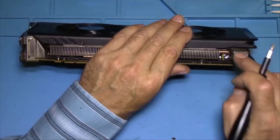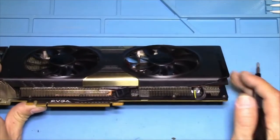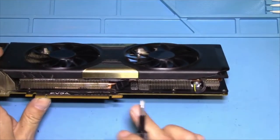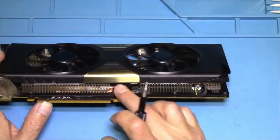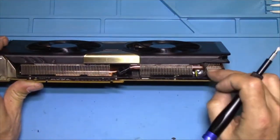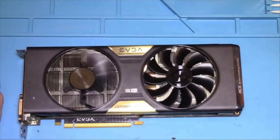When we do learn something, it is nice to be able to share that knowledge with others. Even though it's a little bit of finagling, I finally got it started. I'll just use the screwdriver to seat it down. On this particular fan, just make sure the wire — I'm going to put a link to it in my description. If you have this graphics card, even though it says it's made for it, you saw it for yourself — this wire definitely is not made right. You just have to be careful and keep testing that the fans are not rubbing. No rubbing.